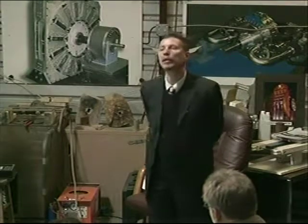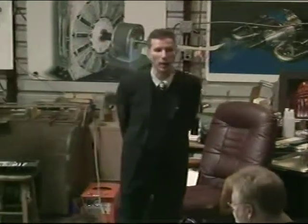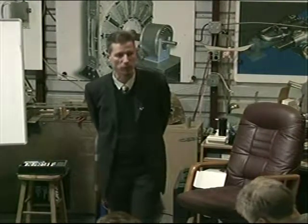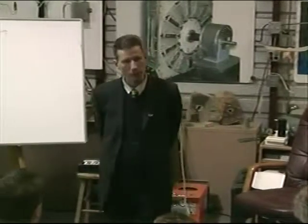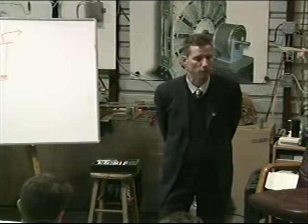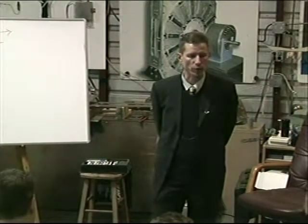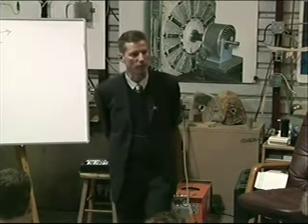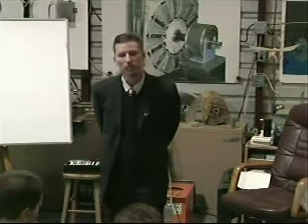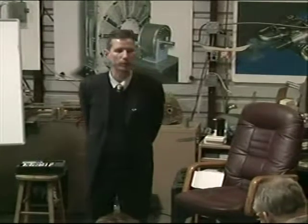If we were to take a voltmeter out here and check all the cars in the parking lot, the output's going to range from probably 12.9 on a pretty weak setup to as much as probably 15.8 volts. And so if you've got a high voltage, then you might want to drop the amperage down to like 14.5 amps or something. Temperature of the unit will make a difference also. So if you have it mounted right up tight against a radiator or heater hose or something, doesn't get any airflow, it'll be more apt to foam than if it's somewhere mounted cooler.